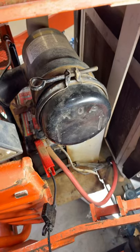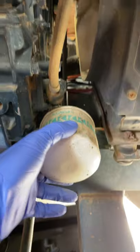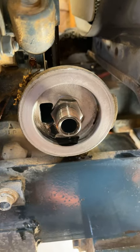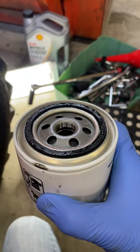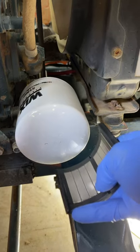With the air filter installed and our two oil plugs back in place, we can move on to the oil filter. Simply grab it and take it for a spin. With the old filter removed, the gasket mating surface clean, and our new filter gasket lubed, we can spin on the new filter. Then I can install my filter magnet.